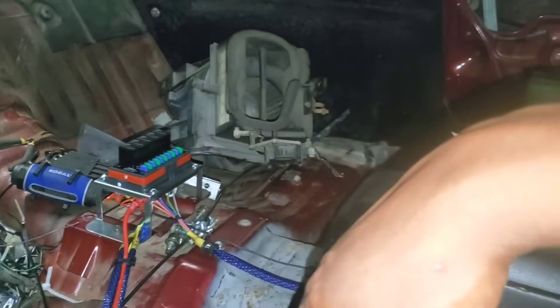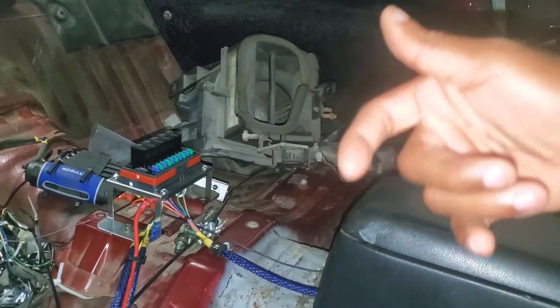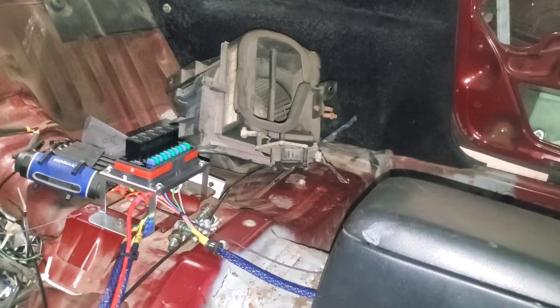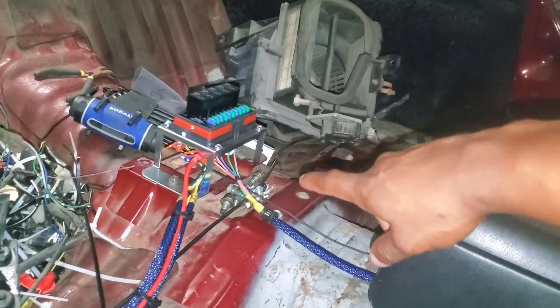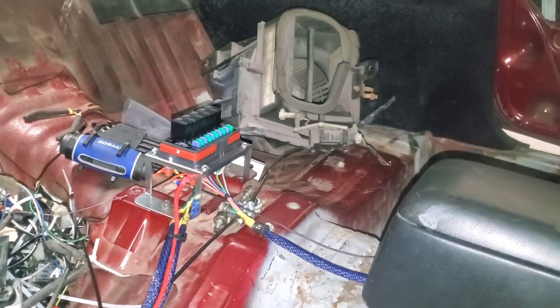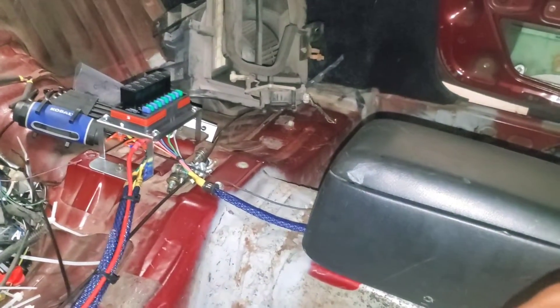That's pretty much it. It's honestly not that difficult once you go through, research everything, look at all the pinouts. It was just hard to find all this information in one source in a semi-short video, so I'll drop links to all the videos and websites that helped me in the description. This fuse box, pre-built with mounts and everything on eBay, was like $170 — not bad, especially considering that the Wiring Specialties S14 chassis harness that matches all the stuff I need is like $2,000. So you buy that for almost $200, get some heat shrink, some sleeve, reuse wire from the old harness, and you can make it for maybe $300.